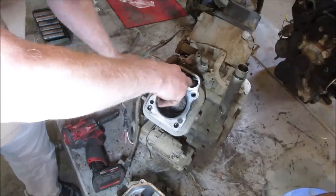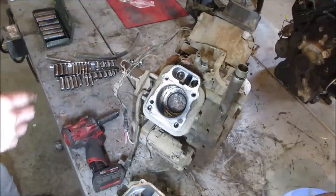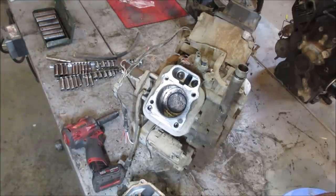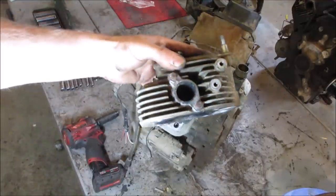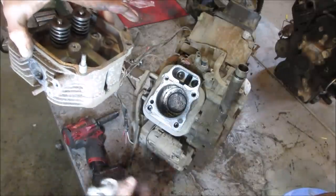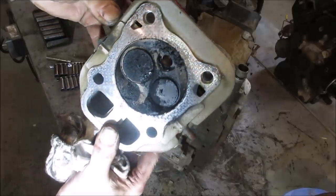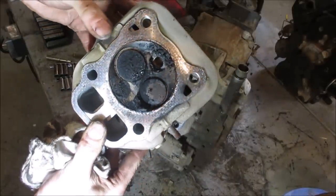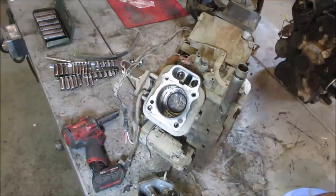So I would think we could probably clean up one of those two cylinder heads. We'll take them apart, take the valves out of them. And my guess is the one that had the water in it, the valves were probably the ones that were binding. Again, I should have marked them when I took them apart, but it just wasn't a priority at the moment. Before I even started, it already had bent push rods when we went to look at it. Let's go with that. What is that? A piece of brake line fell out of it. Let's clean this one up and we'll get the valves out of this and see if this one could be savable. Between the two of them, we should find one good one. And we'll plop it back on, put the rockers on it, and the starter's still on, so we'll be able to do a compression test and see what we get back.